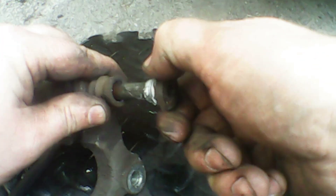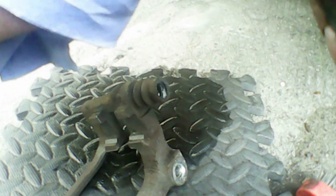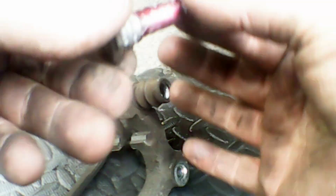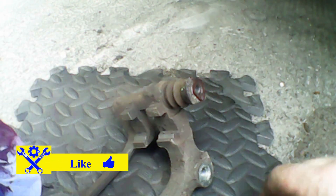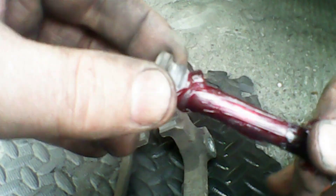Now I'm going to whip out the old caliper slide pins and grease them. You want to do one at a time because they are sided. Give each one a good wipe and clean, hit it with brake cleaner and give it a quick wipe. I'm also going to clean out the rubber boot with a bit of paper towel. Now I'm going to use some red rubber grease — this is my favourite lube for slide pins. Just give it a nice coating and slide the pin back in, making sure everything slides and moves as it should. Now I'll do the other side the same way — it's got a slightly different marking on it; this is the bottom one. Just give it a good clean, clean the rubber mount as well, put more red rubber grease on, and slide it back in.